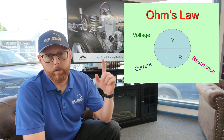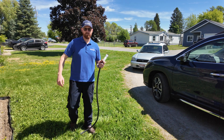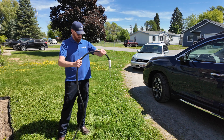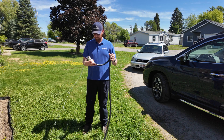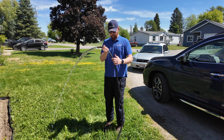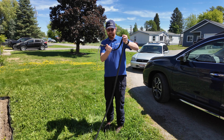Let's go back to Ohm's Law for a second — voltage, current, resistance. What do these even mean? The best analogy I can come up with is a garden hose. If you have a garden hose and it's turned off, you have no voltage, no pressure, no potential. You turn it on, and if you kink it, the pressure that builds up on the other side of the kink is your voltage — the electrical pressure or potential inside the circuit. That kink is the resistance. The last obvious thing is the current, which is the flow of the water. If you undo that kink, you remove the resistance and current can flow. And it works the opposite direction too — if you slowly kink a flowing hose, pressure builds up and flow gradually reduces. That's where voltage drop really comes in.